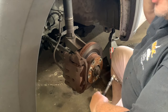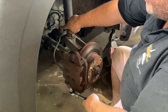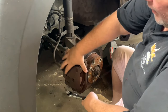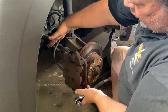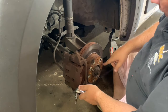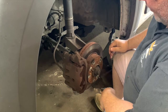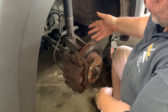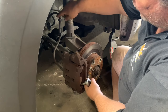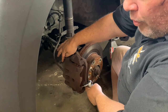For those of you who don't know how this works: this is your brake line. When you step on the pedal, it pushes a plunger which pressurizes fluid, and the fluid comes down this line and pushes right here. This is called your caliper, and just like on a ten-speed bike, when you put the pressure in there, it squeezes the pads together. The pads grab over this — which is called the rotor, named so because it rotates — and that converts kinetic energy into thermal energy and slows the wheel down. We won't be doing this today, but this would be your bleeder screw. When there's air inside the caliper, you need solid fluid, so the bleeding procedure is to push more fluid through and push the air out at the highest point gravity-wise in the caliper. So don't try and bleed your brakes when the car is upside down.